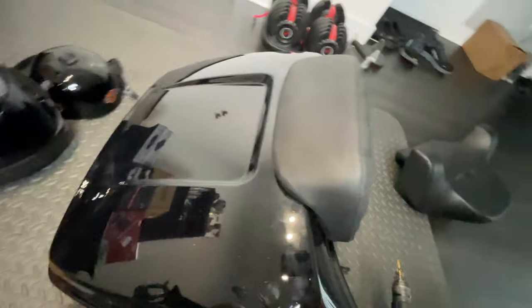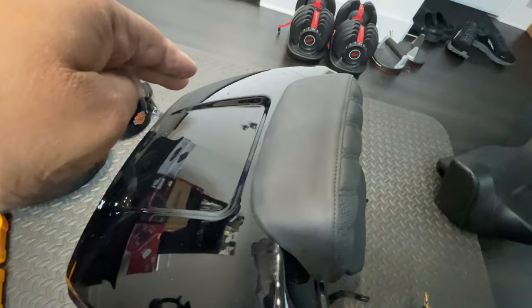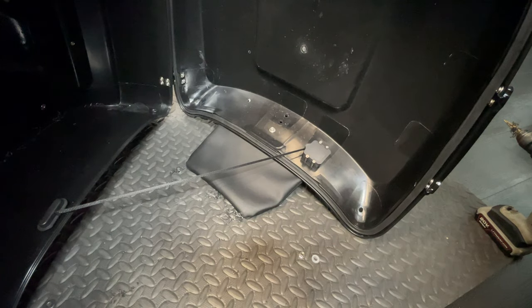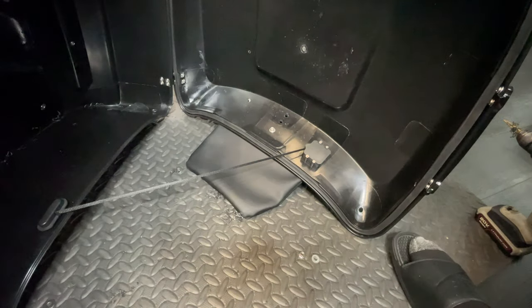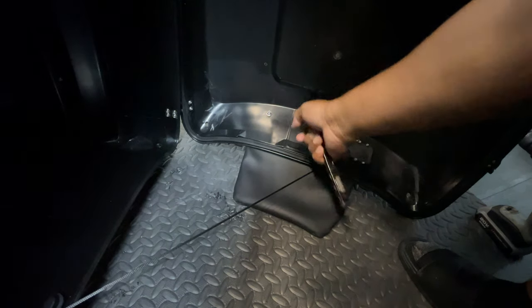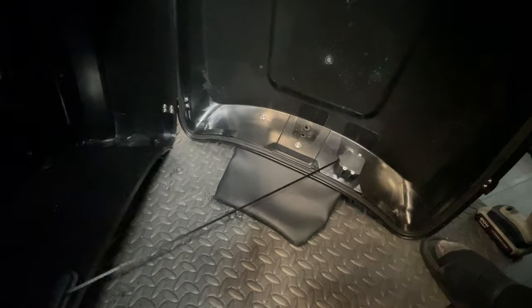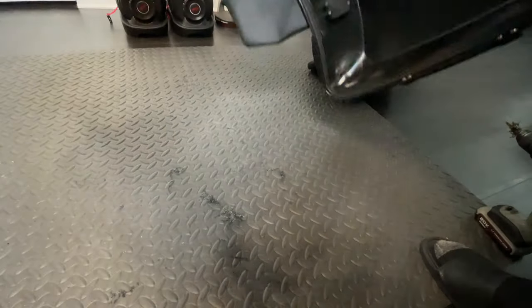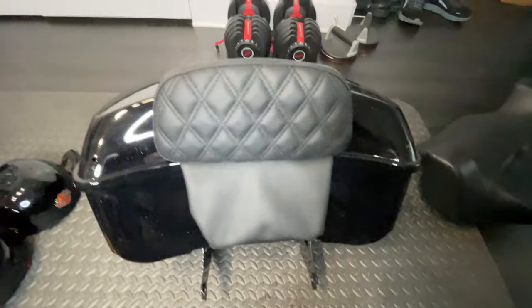Looks pretty good, can't wait to get it on my bike. I did have to go a little deeper on those holes than I expected - had to angle the holes up just a tad bit. Getting the second one bolted in. Don't use power tools on plastic if you don't have to - it only makes things worse, I had to learn that the hard way. Once again, make sure you don't over-tighten; I probably should have some kind of torque wrench but I don't. Get all these shreds out - that should be it. No casualty of paint and yeah, looks a lot better.